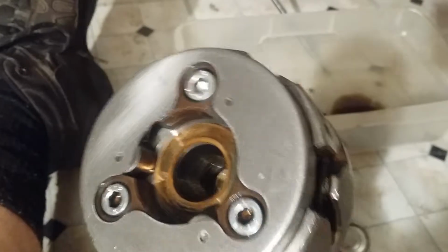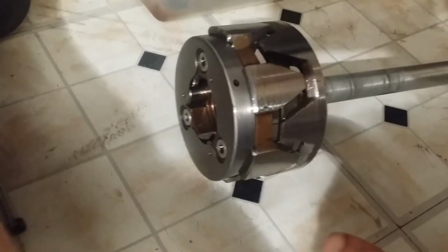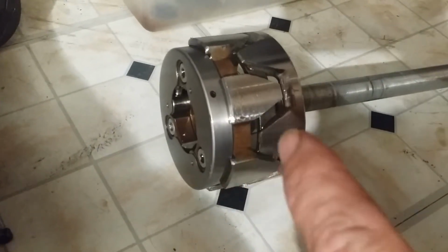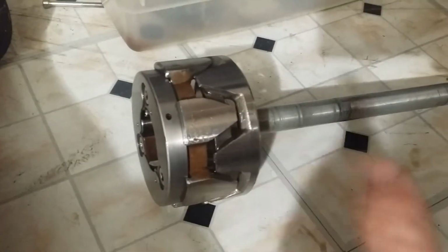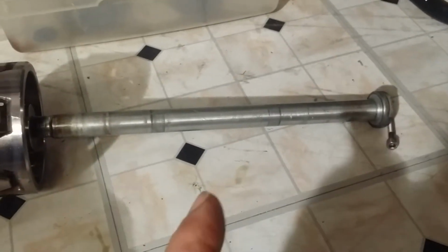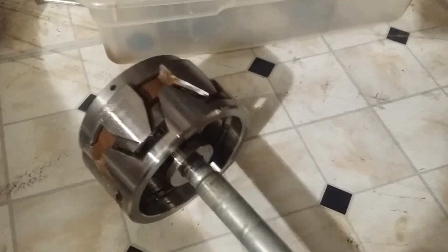But yeah, anyway, when I get those parts, I'm going to show you. They should be coming any day. And that usually means a week. But when I get those parts, I'll show you what I'm talking about, put them in. There are some videos already on the internet and on YouTube and stuff if you don't want to wait. But just as to confirm, the rear axle is great for a rotor puller, flywheel puller, whatever your case may be. It screws right in there, worked perfect, and it doesn't hurt the threads or anything. It still works perfect, screws in and out.